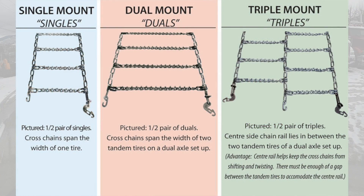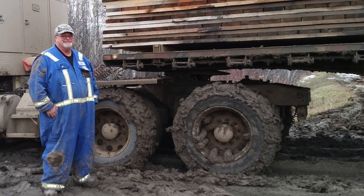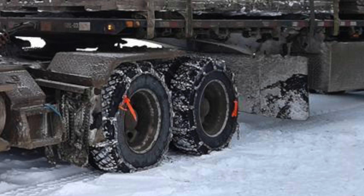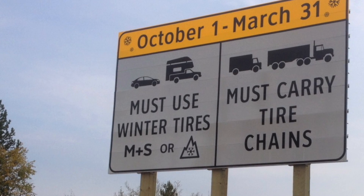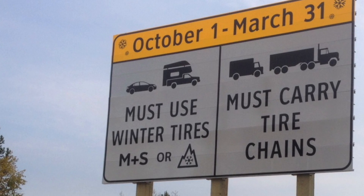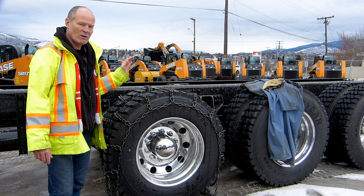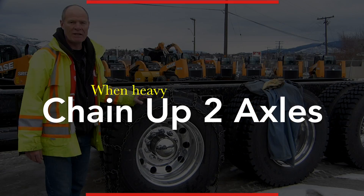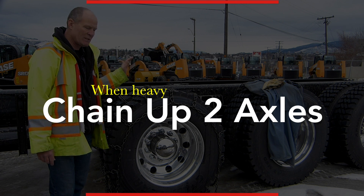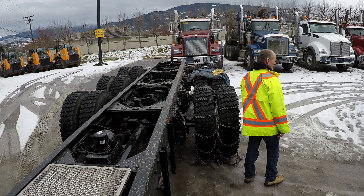These are real chains — these are triples. They're not cables or some other sort of knockoff that you can use going up and down the highway in British Columbia. If you're running in the bush doing logging, in the oil fields, or up and down the Coquihalla Highway or the Snoqualmie Pass, you're going to need a set of these. Here in British Columbia, you have to have them on your vehicle and ready to be fitted between October 1st and March 30th. There are particular ways you have to chain up your vehicle — I'll put a link in the description and you can find that sheet over at the Smart Drive Test website showing which axles you need to chain up to be legal.